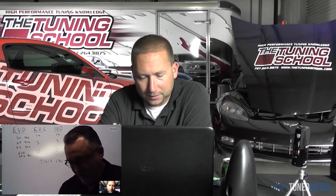Here's the other interesting thing about this 0.3 number, because we do a lot of truck cams. What does a 4853 truck cylinder head have for intake valve? They're tiny. 1.89. So that comes up to 567 lift. People are trying to shove all this big lift in those truck engines. Not happening. They're past the point of diminishing returns, and that's really what this number is.